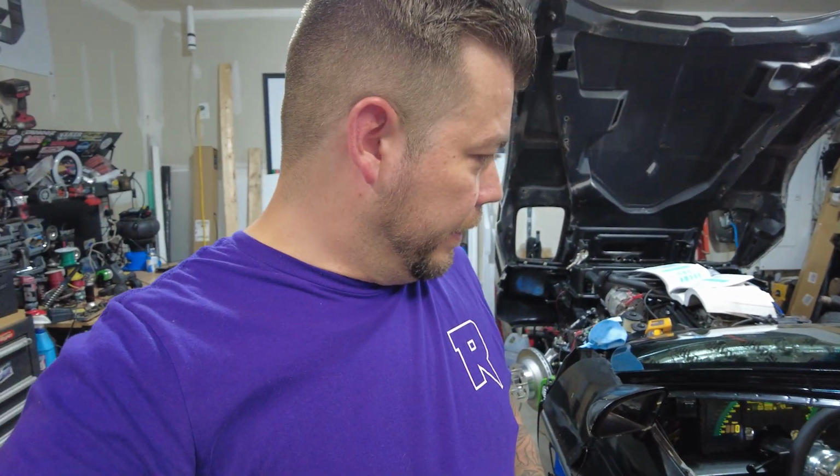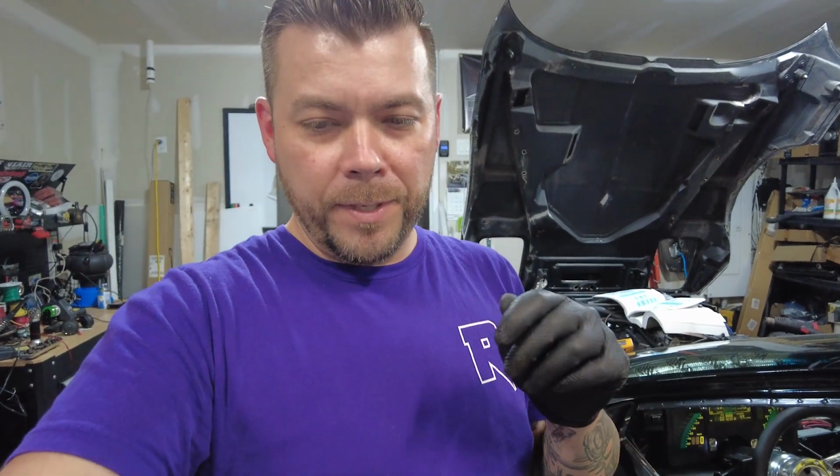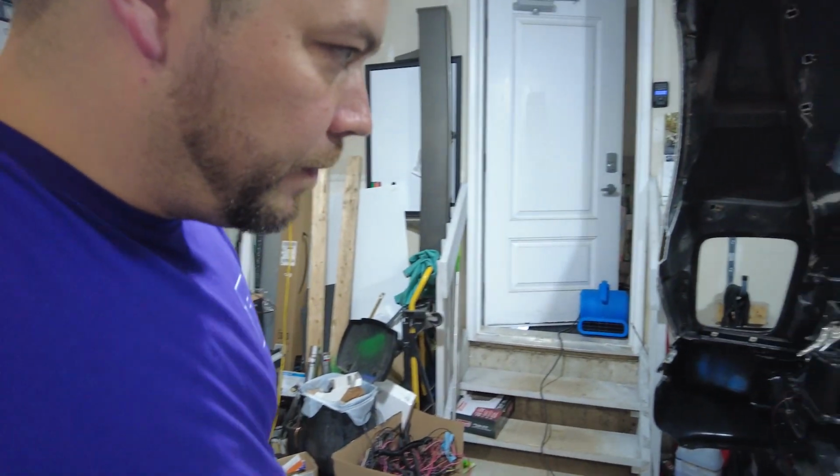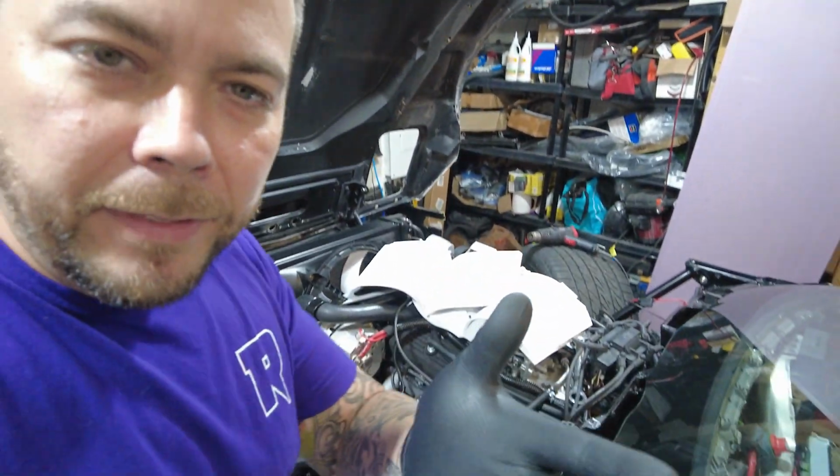Okay, so that is a problem. It appears that the coolant sensor plug is actually the oil pressure plug. For some reason, I don't know what happened there. I must have got the wires mixed up. I tried the plug from the oil temperature sensor on the coolant sensor and it didn't work. So I dug into this wiring down here. And obviously, you know, read some books and things like that.